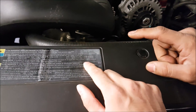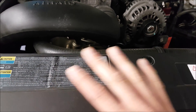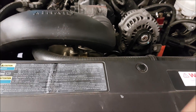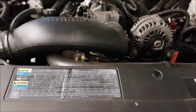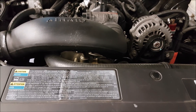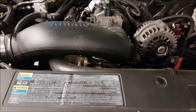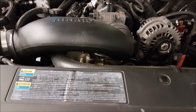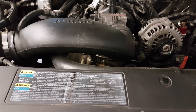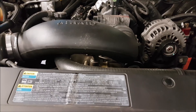If you're running way below — we were at 0.726 and measured at about 0.515 — so if you're at say 0.3, the whole system electronically will work a lot harder because it has to keep going. The compressor has to keep working, and sometimes that kills the relay or the fuse. So we should be recharging it on a regular basis, keeping it full and re-oiled. Vehicles that run summertime a lot — two to four years, or to be safe, three to five years — would be a good service interval.